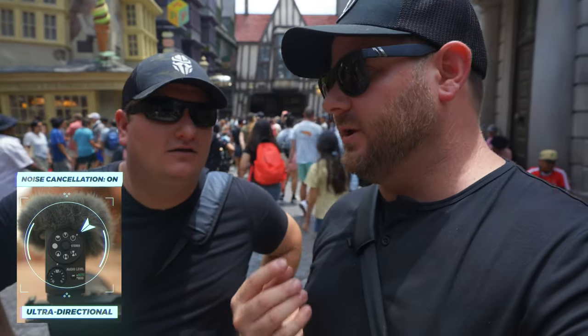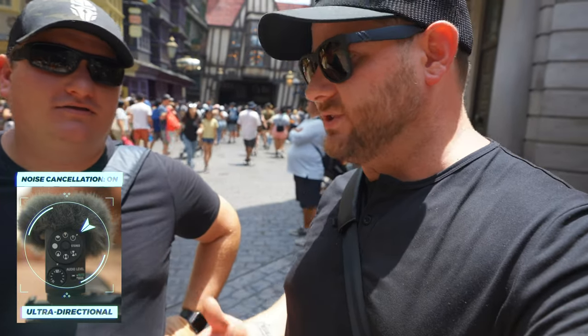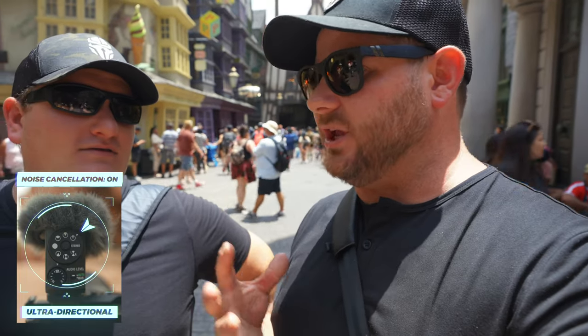There is one other setting on this microphone that's also pretty interesting. It's still going to be a front and rear facing microphone, but it actually splits it into a right and left stereo channel. So you can actually edit it in post and switch the audio levels — if one's too loud or one's not clear, you can EQ one differently. The mode we were just in was actually mixed mono, so they were mixed together.